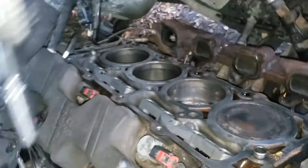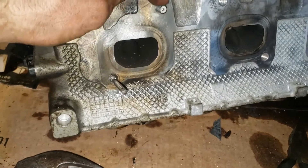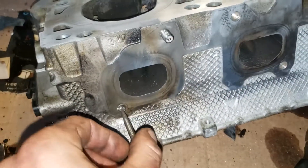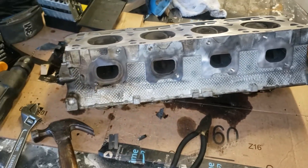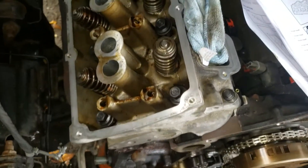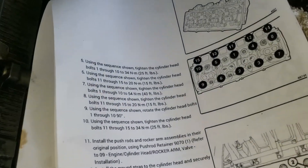Here we have our cylinder heads. In the past someone has broken the back exhaust bolts on both cylinders — the bolts are broken. Using a drill and a screw extractor kit, it looks like they're coming out, so we can install new exhaust bolts and seal the exhaust properly with no leaks. I've dropped the heads back on with new gaskets and new head bolts — obviously because the bolts stretch, you don't want to use your old ones, always use new. Let's go ahead and tighten them down to the torque specs.